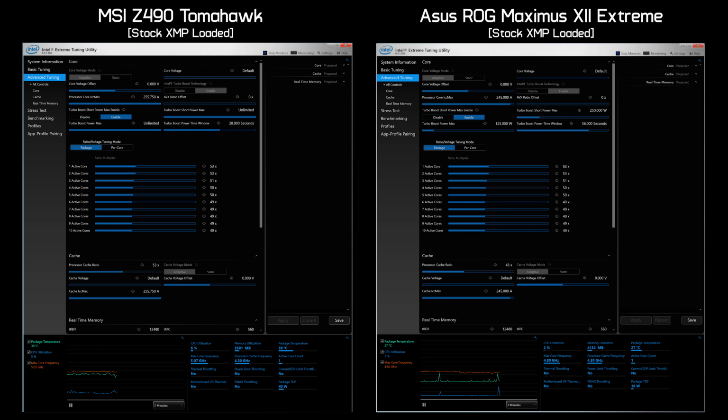But when compared to the 3900X, the 10900K was 19% slower. So that means it's positioned between the 8 and 12 core Ryzen processors, and while that's hardly shocking news, it is a pretty rough place for Intel's new 10 core part to end up, given the 3900X can be regularly found on sale for a little over $400 US, making it cheaper and faster. But before we draw any serious conclusions, let's move on to check out a lot more data.